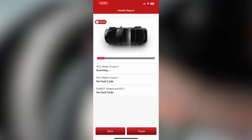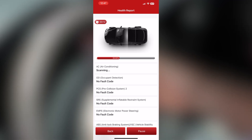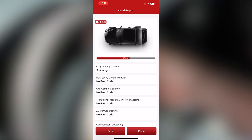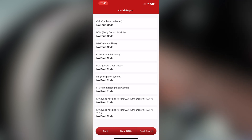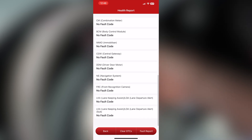As you can see, it's scanning the entire car: ABS — anti-lock braking system; VSC — vehicle stability; SRS — supplemental restraints; OD — occupant detection, no fault code; AC — air conditioning, no fault code; TPA; CM — combination meter, no fault; CC — charging control, not equipped; SR — sliding roof, not equipped; TD — theft deterrent, not equipped; FRC — front recognition camera, no fault code; LKA — lane keeping assist; LDA — lane departure alert, no fault code. It has scanned the entire car and this car has no fault codes, which I knew before I ever hooked up to it. This is my 2019 Toyota Corolla and it's showing no codes whatsoever.